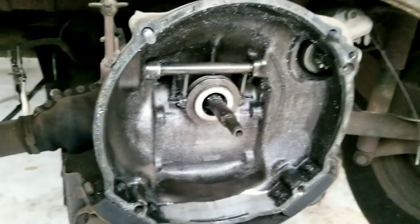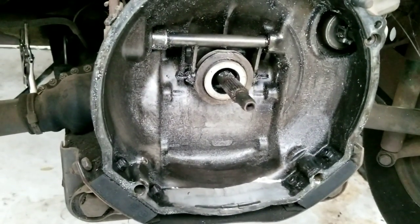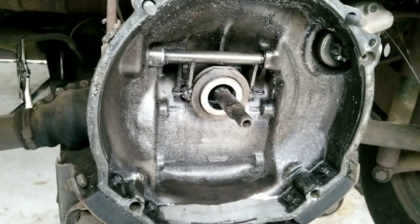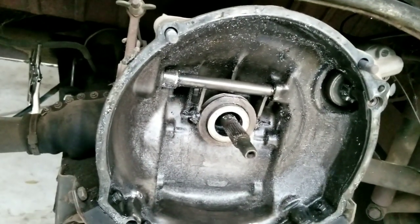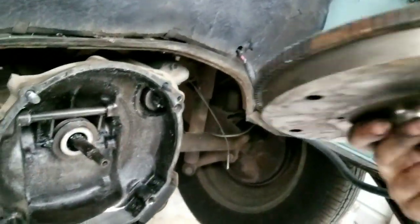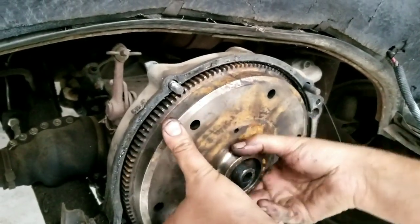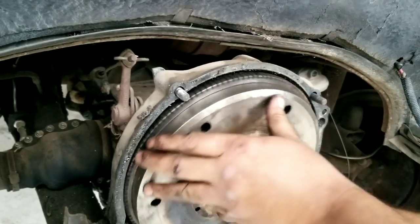What we're going to do is get this one ready. What we do to do this job is take the old flywheel or the new flywheel and a gland nut. It's best if you have a gland nut. We found one, so we put the gland nut in there, put the flywheel in, put it on the shaft, and use that as a guide. You can put it in there and then turn it a little bit, and that'll help you find those places where you need to grind.